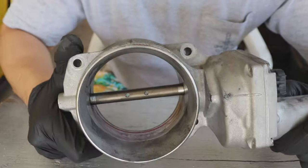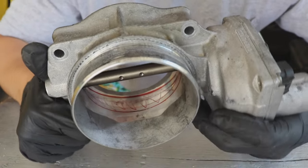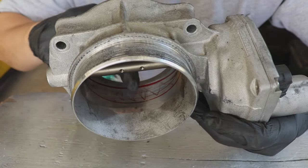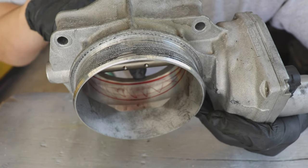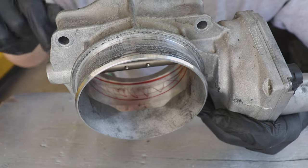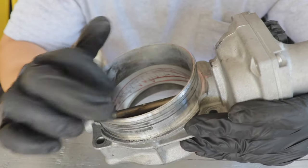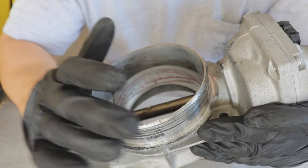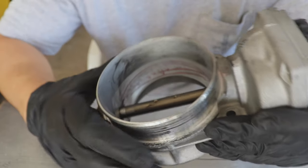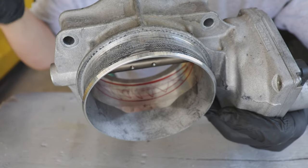Now that we've taken out the middle piece, let's go back to the red lines we drew earlier. This is the resting and fully closed position — there's one red line there and another one here. Anything between those two red lines we don't want to touch, because it can cause idling issues. Basically, if you mess up this middle portion, your car will idle high when stationary and you'll have to buy a new throttle body. Just be really careful — remember, we can always take out more but we can't add back on.